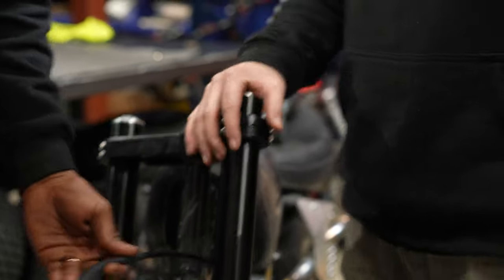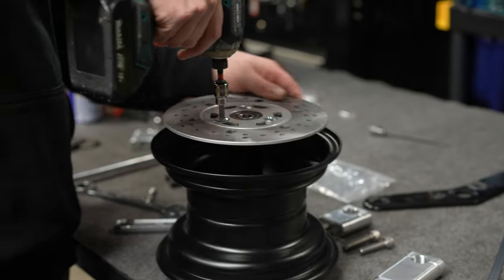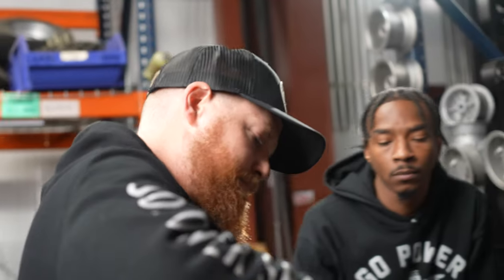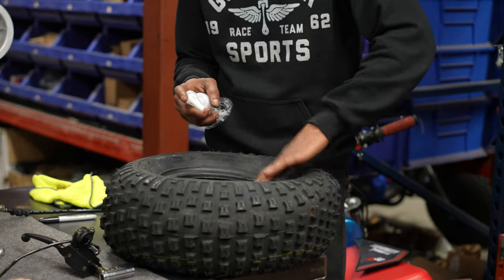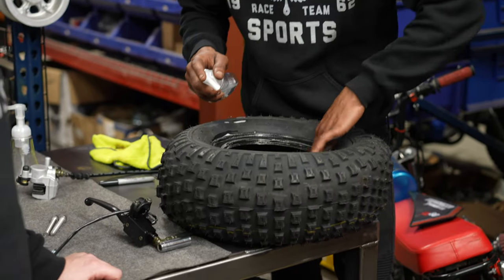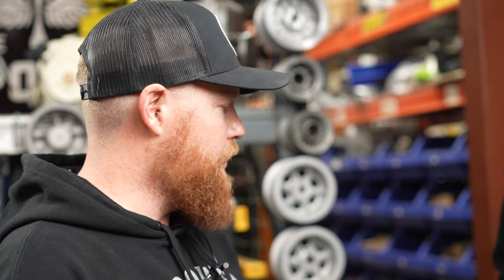We've got the whole premium front end on here. We're going to take the wheel back off to mount the tire using our vise — not a tire machine. We'll take the disc off first, get it mounted in the vise, and slap the tire on. First thing is to get the tire lubed up using soap — just hand soap, that foaming soap works really well. When building tires at the warehouse for customers we use Slip Tack, but here at the shop the foaming soap works great.